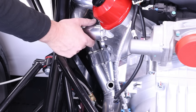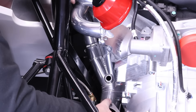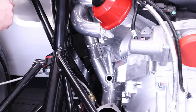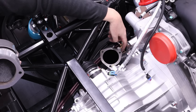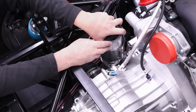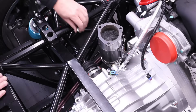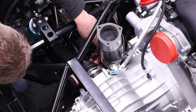There we go — fits quite nicely in there. I'm going to just tighten these up just a little bit. There's a little indent there on that flange so it goes on like that. Pop on the gasket — the reason I'm putting the gaskets on is I just want to allow for their thickness when positioning everything. Just going to pop the nuts on finger tight.